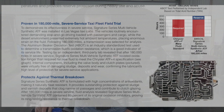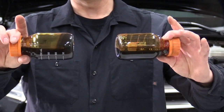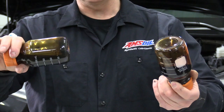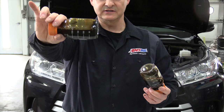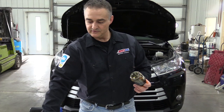The transmission flushes I do — I've got some examples here of oils saved from transmissions I've flushed in the past. These oils actually look like waste oil, not much like transmission fluid. I've saved samples over the last 15 to 20 years, and you can see the crap that's in them. If you do a flush with a flush machine, you never get the filter changed, and you'll recirculate this stuff into your valve body. If this fine dirt gets into that valve body, it hangs it up, which causes the transmission to slip and fail.